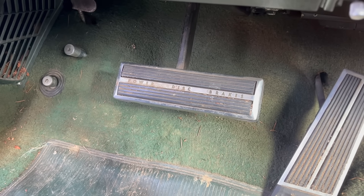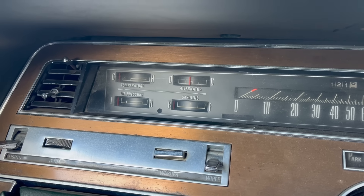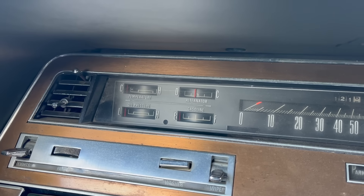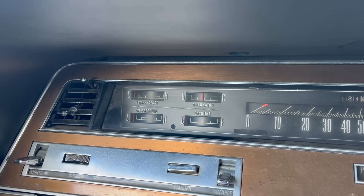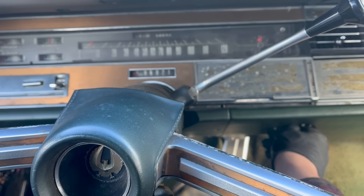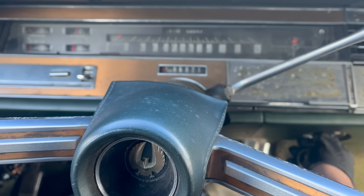Power disc brakes — that kind of seems like a Ford thing to do. Now this is interesting. With the running lights on, the brake lights work, and we know that because of the dip in the amp gauge — but I also had Tom check. With the running lights off, though, there are no brake lights. I'm confused. For science, let's see if the starter does anything. We've got a gas gauge, and all the other gauges moved a little bit, too.